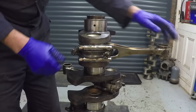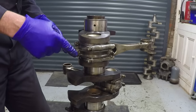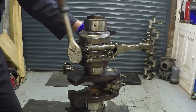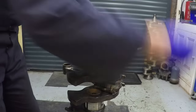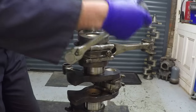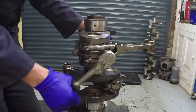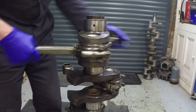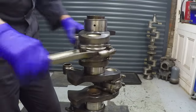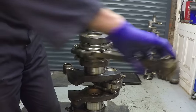We're going to nip these up just like we did before, making sure the bolts are fully home. Because there are only two of these and they're a bigger bolt, we're going to go for a tighter torque range, but we're still going to stretch them. Do them up progressively, up to about there, and check for freedom of movement. On the forked rod we need to check for freedom of movement all the way around, making sure there are no tight spots. This one's lovely - no problem with that.